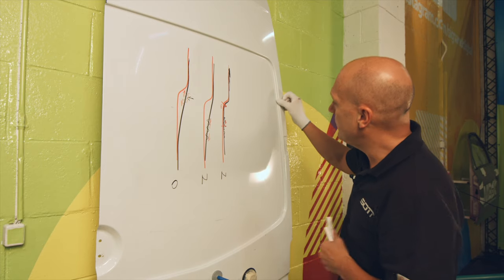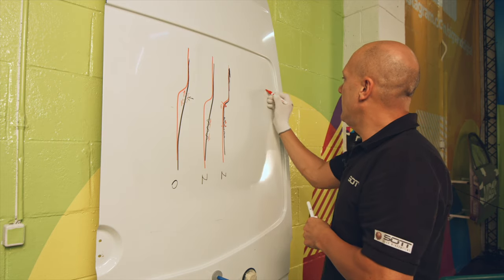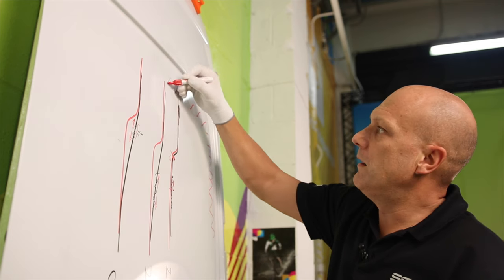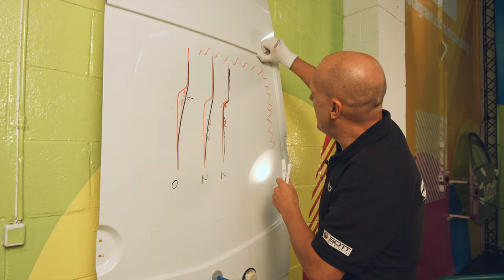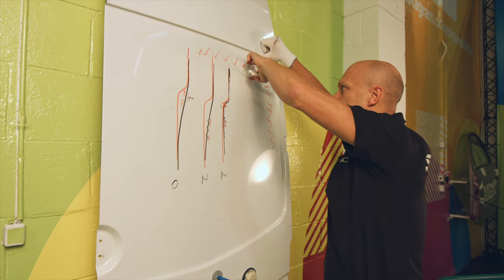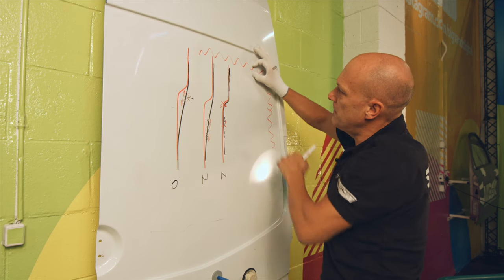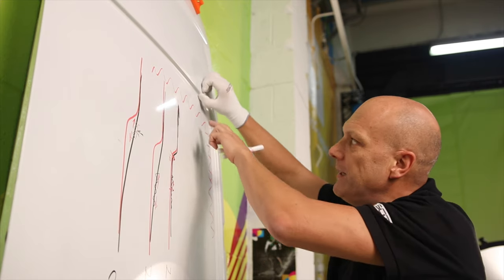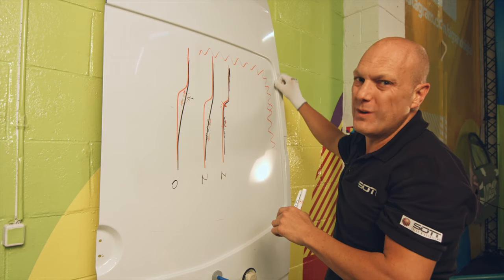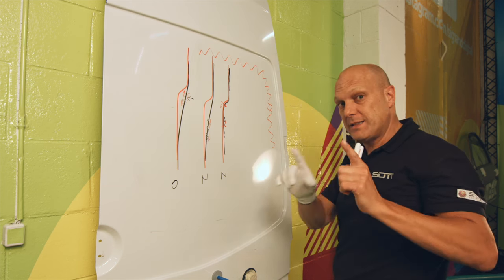So if I install here too, I make it hot on the flat areas on both sides — the hot areas are here and here — and my material goes down. I heat with the heat gun so the airflow goes that way, and I press it firmly on the flat surface so the material stretches outward. That's the way to have no tension or risky situation in the recess. That's how to do it.